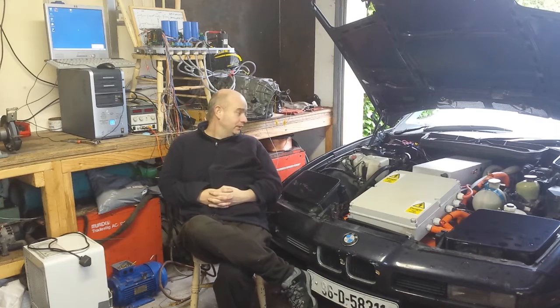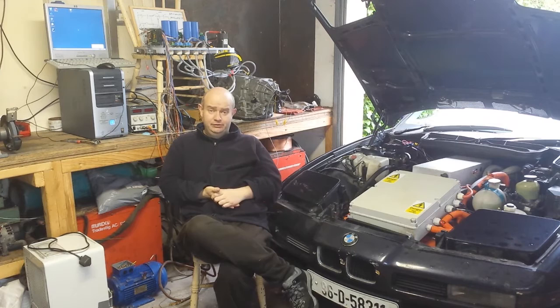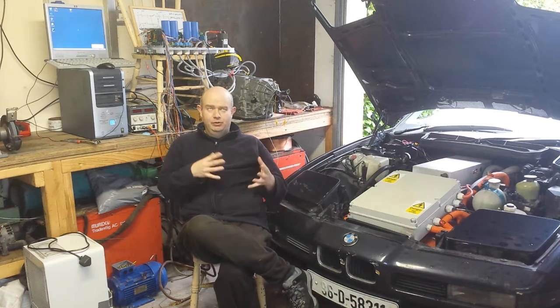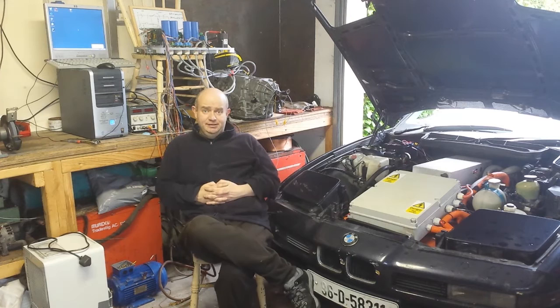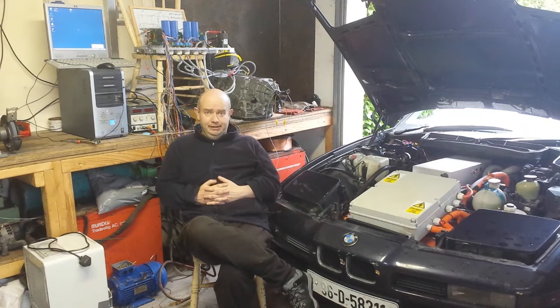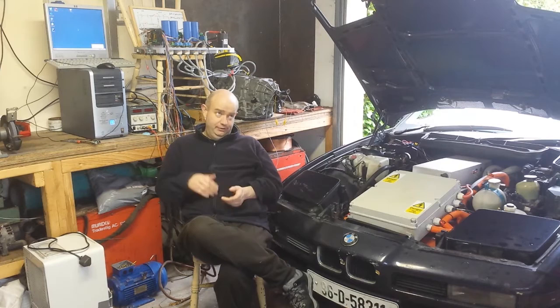With this computer and a very hack-together cable set, I used a board called the Tiny ADS Interface — they're available on eBay for about $20. It connects to the serial port and has a little terminal strip to connect to the various pins that would have been on the diagnostic connector. I connected up just three pins: power, ground, and the K-line to the ABS. And I'm talking to it and reading diagnostic data and real-time data from it.